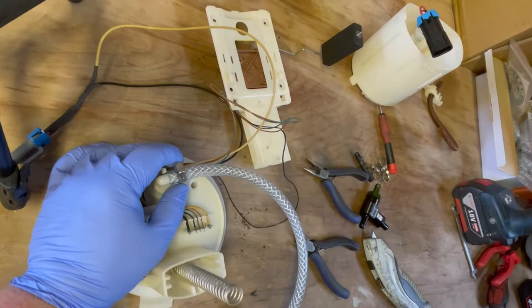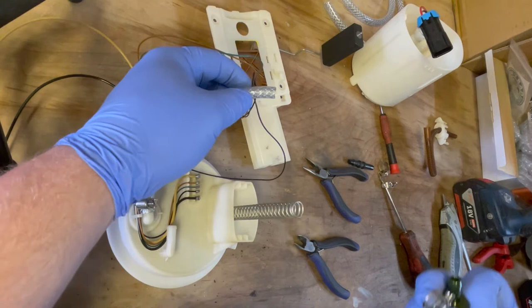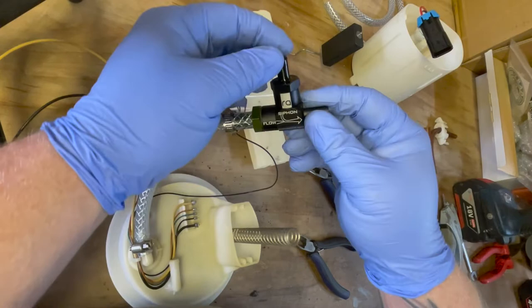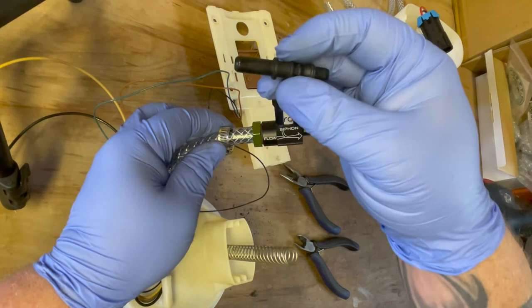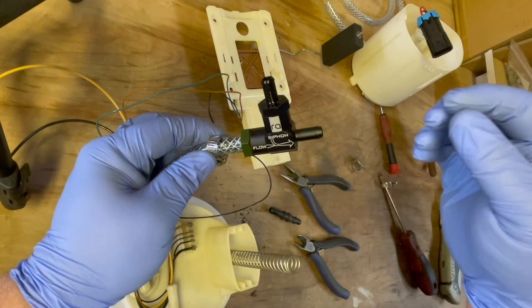From the return line, I've cut the original pipe off and replaced it with a new pipe. The return line is going to go into the flow section — the green fitting. This other side will be connected to the connection from the saddle tank on the other side, and a bit of pipe will connect that and clip into the original port. This section needs to be long enough to reach the bottom of the tank — it must sit below the tank fuel level so it doesn't suck air back up.